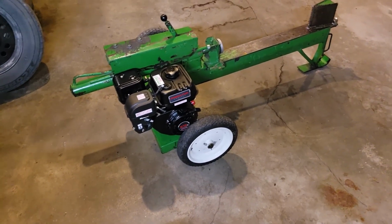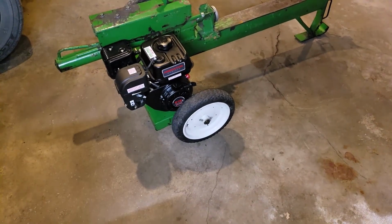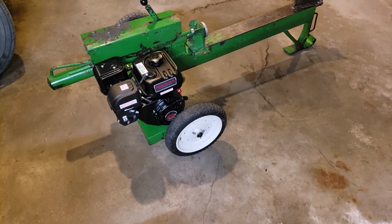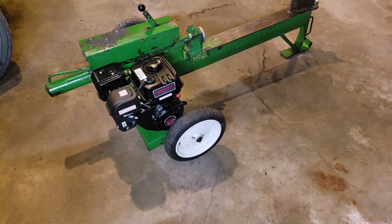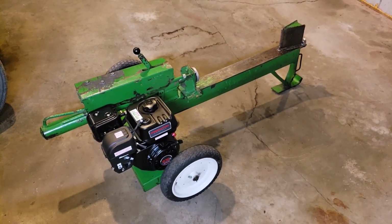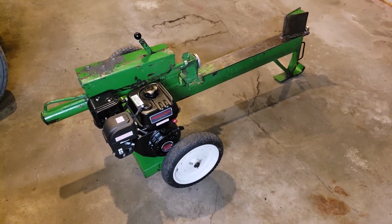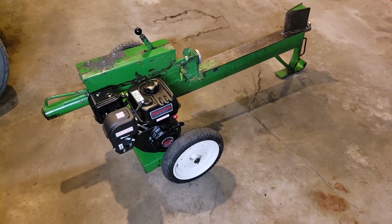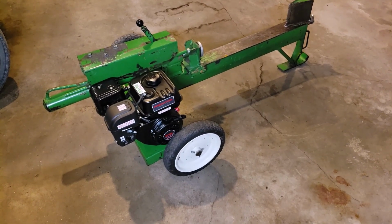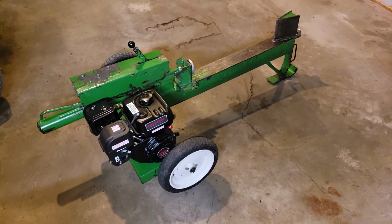We're just gonna let it run itself out of gas, and it's gonna empty the fuel line, and we'll park it outside. And then tomorrow we'll get some wood cut with the chainsaw, and we'll try it. We'll make sure we put it through the paces with a couple logs. I'm sure Drew would like to put it through the paces with some logs, just to be sure. And then you'll check the bolts again on the pump coupler, where the pump is mounted in the engine. Just make sure everything is tight after a bit of run time.